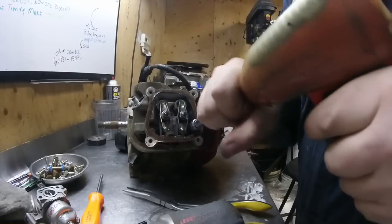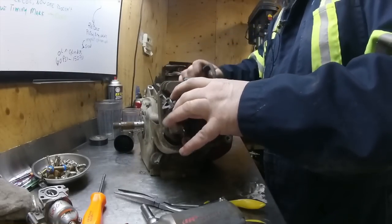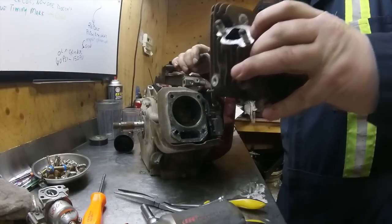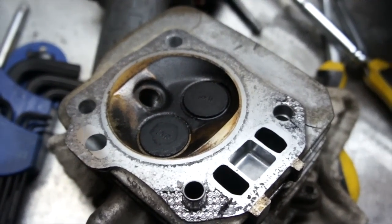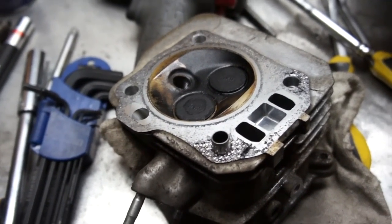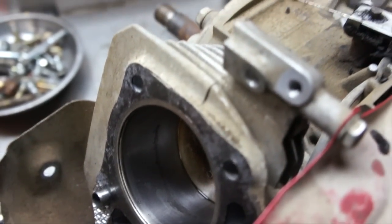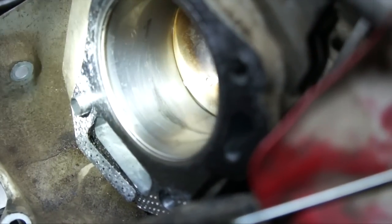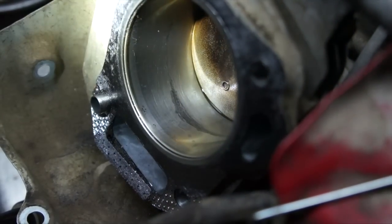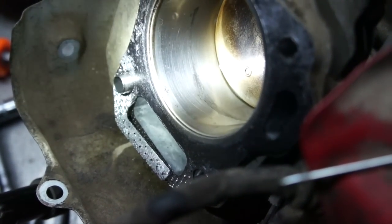Here goes nothing. This is what we're up to right now. The cylinder head does not look too bad — if you wanted to, you could probably put new valves in, but they're pretty good. However, the problem is something I didn't see with the borescope. We're gonna shine a light inside to get a clear look. Do you see that dark section on the bottom of the cylinder there? That is the plating that has flaked off.